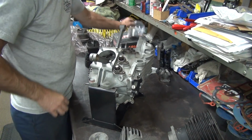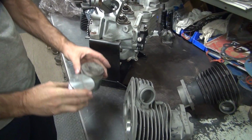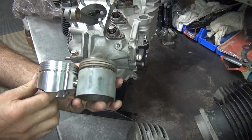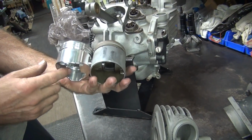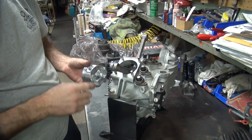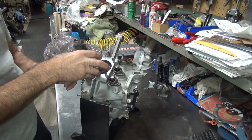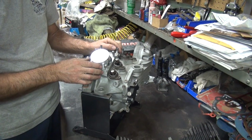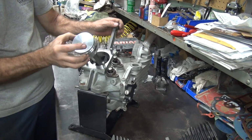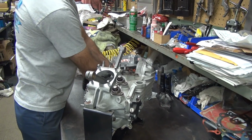So there's a stock piston. A little difference in sizing. See how that top ring was poked all the way out of the cylinder, see? And this here is clearance because the flywheel's getting way down low. So it comes way on down. Which we assume there's clearance for. I haven't checked yet though. We still have a lot of stuff to check. Oh. No. Appears to have clearance there. That's good. So we have it cut away enough. This will make the flywheel balance better too, being lighter. That's always a good thing.